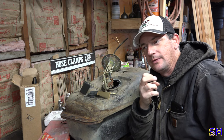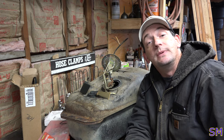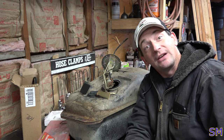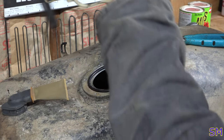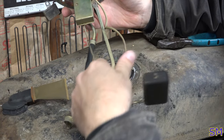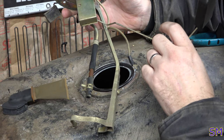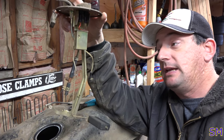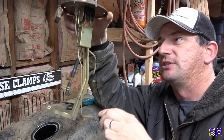And work on the next supplemental thing that we have to do while we're waiting for the engine to be finished. So, let's tear this apart and put it back together again, the wrong way. Try to test on this. This would be our level sensor device. Up here, it measures and bounces around on the ohm meter, but once you drop about to here and all the way down below, the meter goes down to zero. So, let me bring this to the microphone and I'll show you how crunchy it sounds when it's all in the up position.